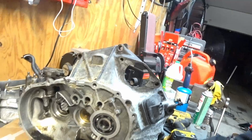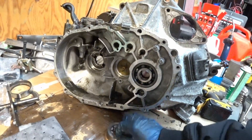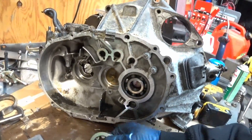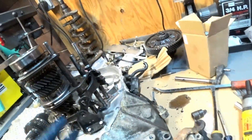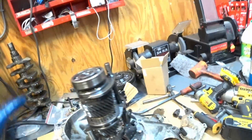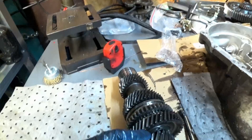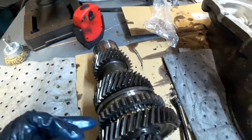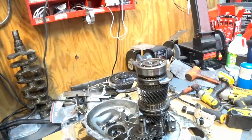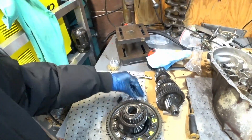The bearing still seems to be in good condition. I just gotta make sure I keep track of orientation - this was the bottom, and these two dots are face up. Everything - all the parts I need - I already took out. More than likely I'm gonna possibly rebuild this one for another purpose, but for right now the main parts I need are already taken out. These are some good gears and the synchros look fine.